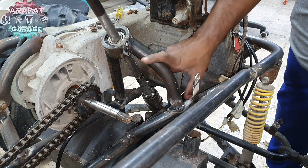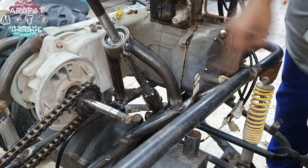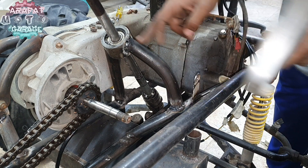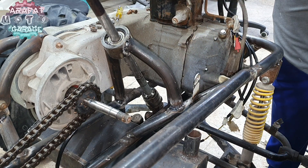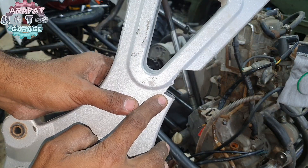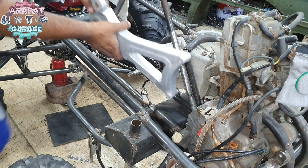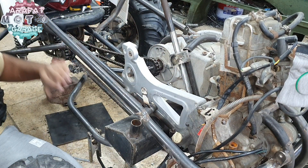In order to do this I have to cut out this pipe from here and install this, figure out a way to get it attached from somewhere else. I also need to keep in mind that I can easily remove this bracket afterwards. I have to make it like this, or else make this bearing support for the steering from somewhere else — a bolt system or whatever. Let's just cut it out first. I trimmed out a little bit here but there's still a main support over here. The complete other side is still remaining. Just a slight trim from here, and yes, it worked out perfect.